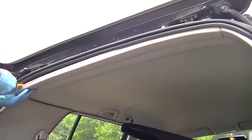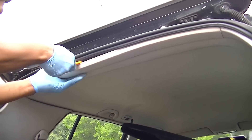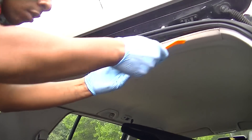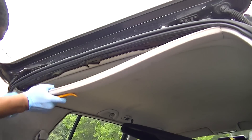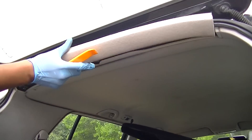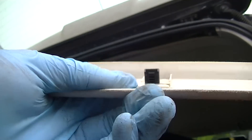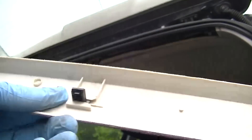I'm doing this with a plastic mold tool — a non-marking mold tool. You just need to slide it behind the trim and lever it down. It goes in with simple little plastic clips, which I'm going to show you here — it's just a simple pull down and they come out. Make sure to retain those clips because you can't put it back on if you haven't got them.